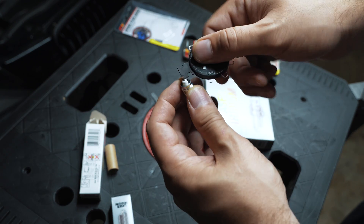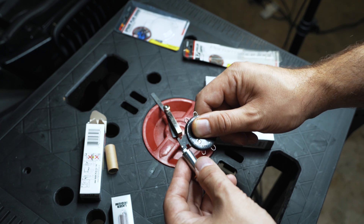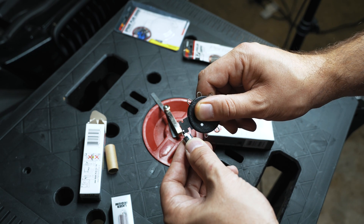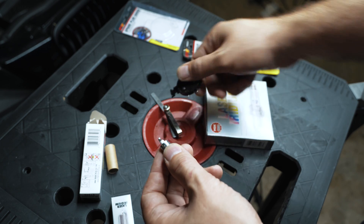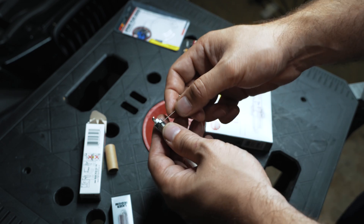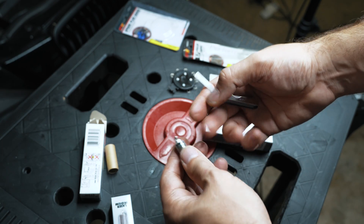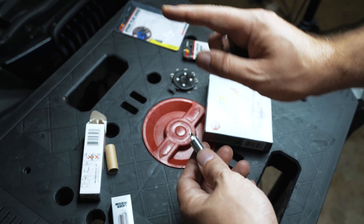With this tool, you can actually rock it down to tighten the gap without banging it on anything. The reason you need to tighten the gap is that when you run high boost, you're more likely to blow the spark out — that's what's happening.